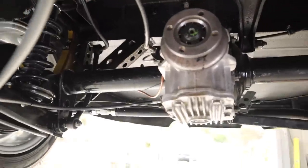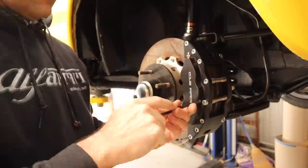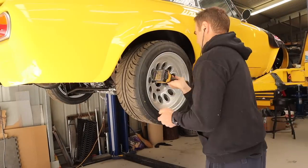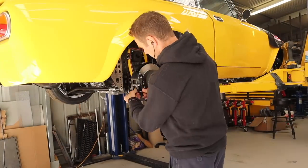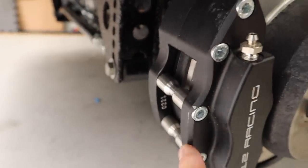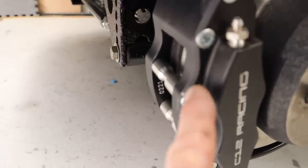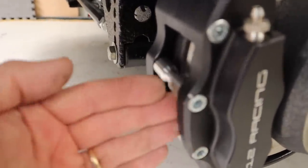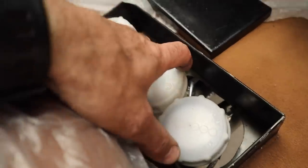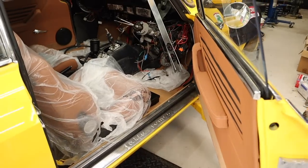It was a whole day of work to get to this, but we now have brakes connected up front and rear. Time to put some brake pads in so we can bleed some brakes. I've got brake pads in all of the C12 racing brake calipers — really easy to install, you just take these two pins out and slide the pads in from behind. The brake master cylinders and reservoirs are all here and ready to go, and the lid will be trimmed in leather.